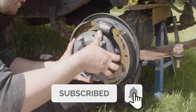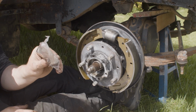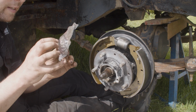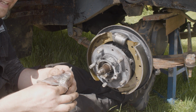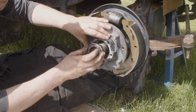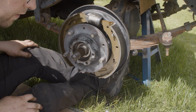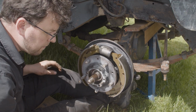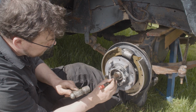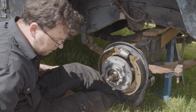So it's not difficult. These bearings just slide on there. I have the other bearing greased, and you can see, because I'm outside, I keep the bearing in its original pack. I just loaded it with grease and then put it back in its original pack. You want to be really careful with bearings like this about the ingress of dust or dirt. You do not want them getting into the bearing. So the bearing is properly greased, and it then slides onto there to take up the clearance. Something I've always done for years, any time I'm installing a bearing like this, is with the hammer and punch, I always give it one or two blows first, just to make sure everything is seated where it should be.